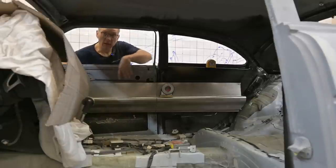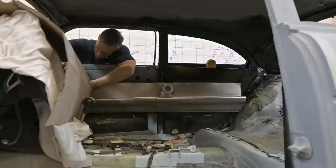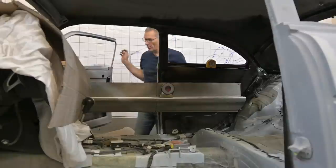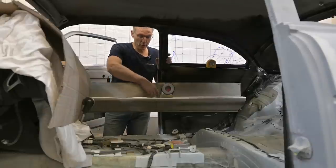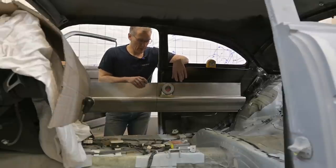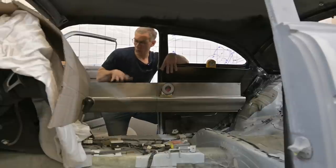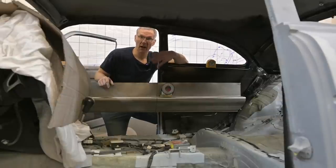I'm going to unlock our door. There are a few screws holding the front. We have to make a cut here and slide this ahead about three eighths to half an inch — just to make sure we have enough room between the doors so that when these panels are upholstered and the trim goes on we don't have an issue of binding. We're going to take this panel out, cut it in half, and remount everything back in the car. For the lower section we're going to need to form that up and attach it to this upper section once this is mounted on the door. This upper section is the baseline we're working from — we'll take and blend the Infiniti's door panel section into this one here, kind of like a hybrid of door panels.